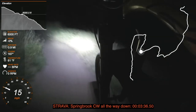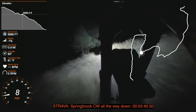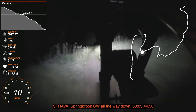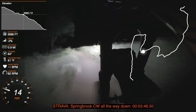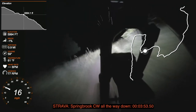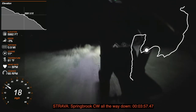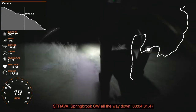For the rebound, with the low-speed fully open, I went through settings on a rough section of Dowdy, from fully closed to fully opened, and in the end I settled on 8 clicks out from closed. So this descent is on 8 clicks out from closed. After doing the descent, I decided it still wasn't quite right, so I did back it off to 7 clicks, but it's interesting how it works.